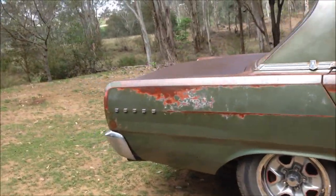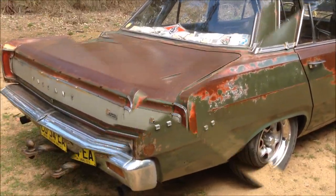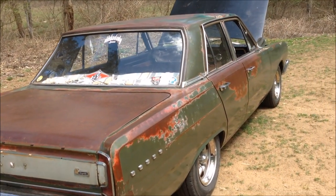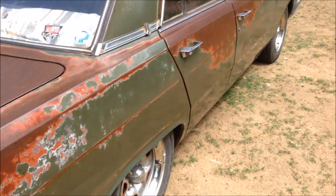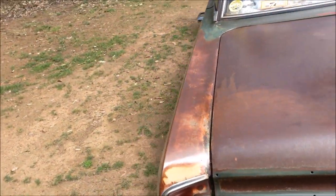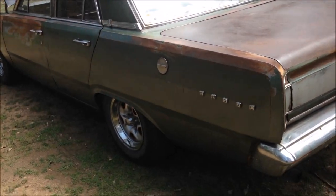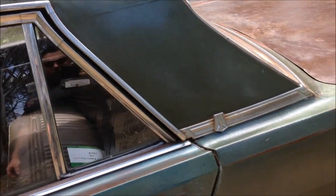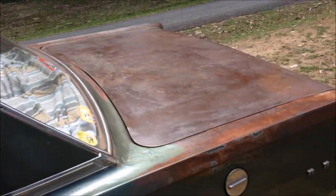The way my back is, I haven't been able to do much, but what I did do to this thing was give it another coat of Penetrol. She was wearing a bit thin, so I gave the car a clean, a quick Scotch-Brite, and wax and grease remover. And then Penetrol applied with a rag in small circles. I've used Penetrol quite a number of times, and if you spray it on, it goes really high gloss and it just doesn't look natural, doesn't look right. You want a bit of a dull finish, so I find with a rag, you don't do it in lines because it'll leave streaks, but if you do it in really small circles, you can't really see it that well. It's got that clear coat over the whole car everywhere, and it gives it that nice finish.